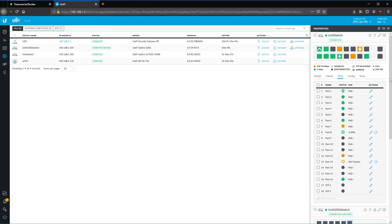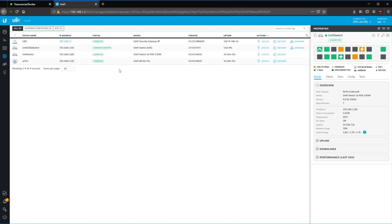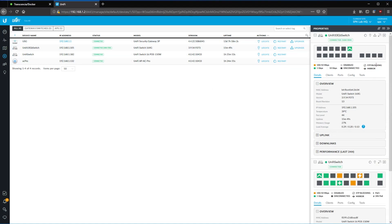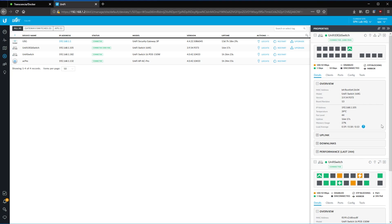It is not active yet. I may have an idea of why — I will be right back. What I did was I unplugged the ethernet port on the 10 gig switch. You may have noticed that port 13 was plugged in via an ethernet port — I've unplugged it and now the connection is showing green. This green indicates, I believe, one gigabit per second, and we can see that on both ends. So we are now using the optical cable, the SFP Plus cable, between the two switches.